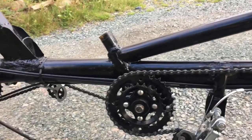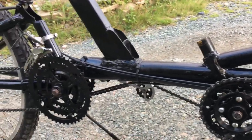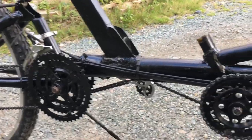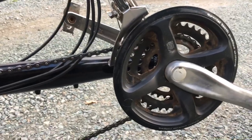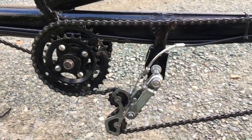It avoids the long chain droop that you get with long wheelbase recumbents using one chain — I've built a couple like that. The chain droop isn't necessarily wrong, but it seems much neater to do it with three chains like this. As you turn this chain it turns the middle chain which turns the rear chain. It's all about mechanical advantage — you can gear it down extra low or gear it much higher than the original configuration, giving you many more choices.